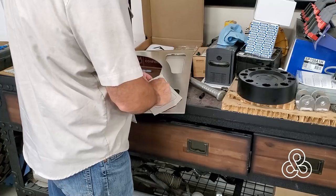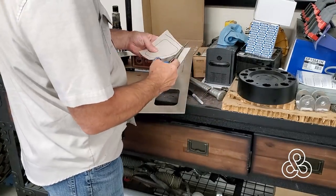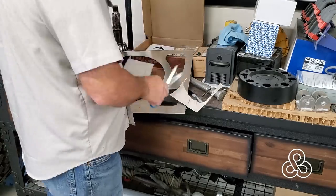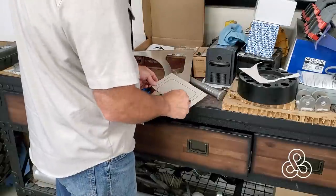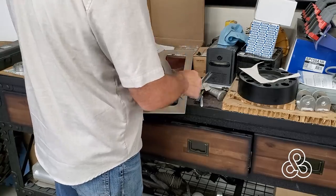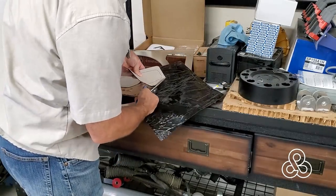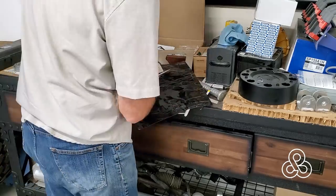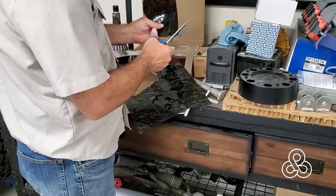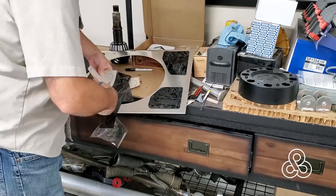I have this fan shroud that's been cut out with a couple of extra holes around the outside perimeter to allow some extra flow when the fan itself isn't running, or when the car is underway and you've got flow moving through from the momentum of the car. To keep those holes blocked off a little bit when you don't want them, I'm going to cut out some rubber sheeting or silicone rubber sheeting. I've just made some patterns traced off the backside of this shroud and I'm going to trim up these little pieces of rubber and get them ready to fasten on.